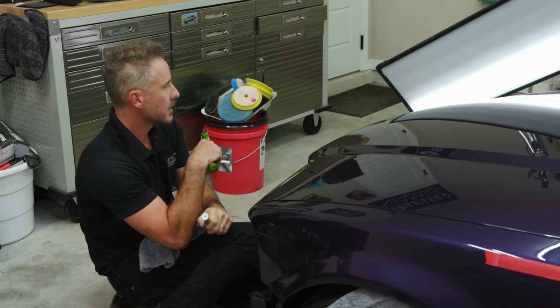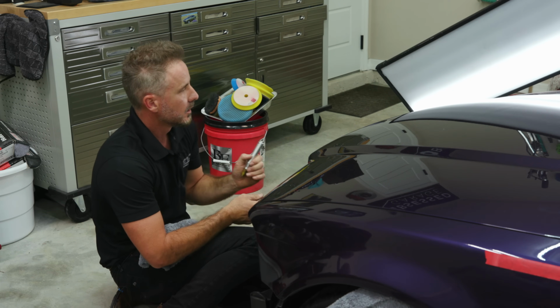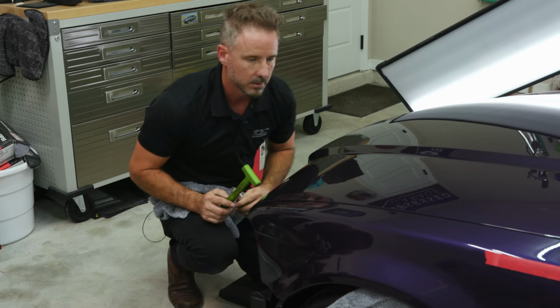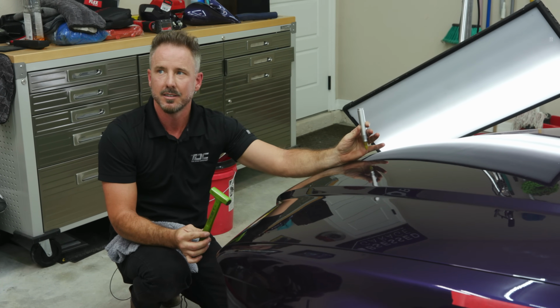But what the light teaches you, and you can see even like some factory things, is what's occurring on a high spot in the light. In my eye, I know this, in the beginning you're looking for metal lift. The reality is the light at the edge of the white bar gets very bright, and then it gets very dark behind it because I'm on this side. So imagine if this is a mountain, and the sun starts to set on this side.